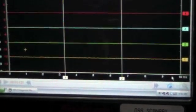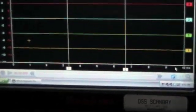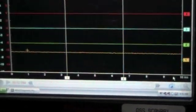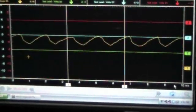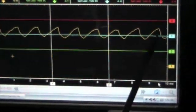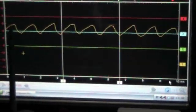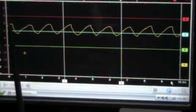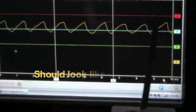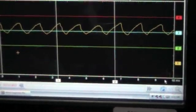We've replaced the fuel pump, so now we know we've got a good fuel pump. We turn the key on and you can see it run for a few seconds — that's a good pump. Now we're going to start it. Again, we're looking at the yellow trace, 0 to 10 milliseconds. You should have approximately eight good pumps across here. They should be a nice sawtooth-type waveform. That is a good fuel pump electrical pattern.